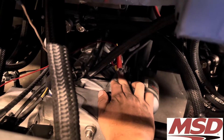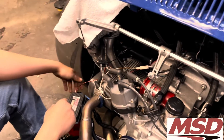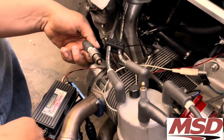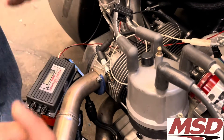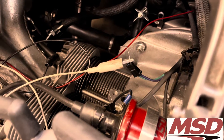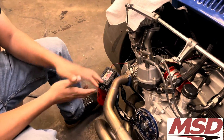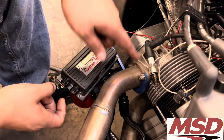What you do is hook up the red wire to your power source — for me that's the battery, which goes straight to my starter. If you have a normal car it could be the positive on top of the alternator. The black wire goes to a ground source; I just stuck it on the head. Then take the spark plug off, hook up a spark plug and ground it — make sure it's touching metal. Then put the white wire to the purple lead that goes to the MSD box. I used a welding rod stuck in there because we don't have the adapter. Now we are ready to roll — the ignition system is turned on and the main disconnect is on.